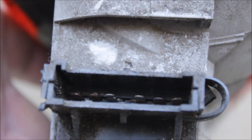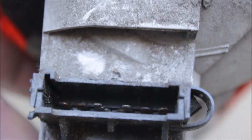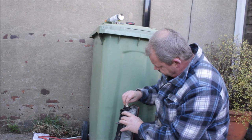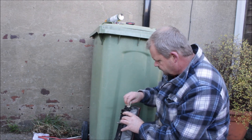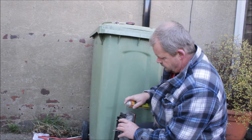A lot of the pins in the light cluster were very rusty, so that would appear to be where most of the problem was. I got a small piece of coarse sandpaper and got most of the rust off, then sprayed it with some penetrating oil — you could use WD-40.